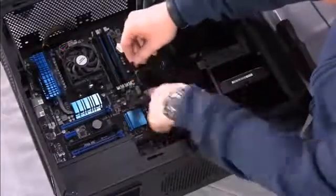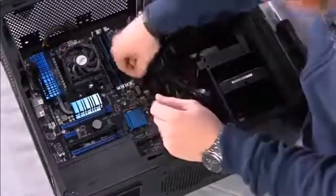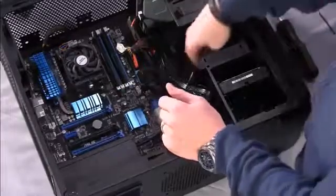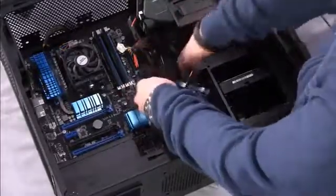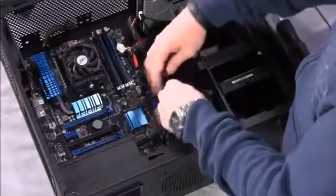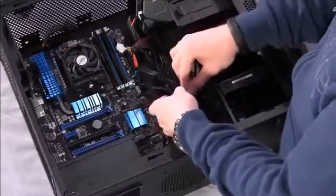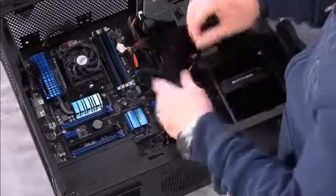Even though this is a 3-pin header and that's a 4-pin connection, you can install it on the 3 pins that are keyed, so it'll only install one direction. And then you should make sure you get this fan cable out of the way some. We'll include it with our bundle of front panel header cables, so it doesn't interfere with the fan blades.